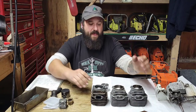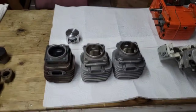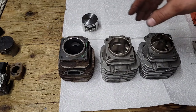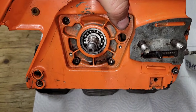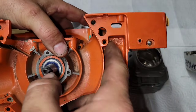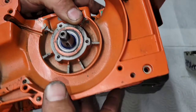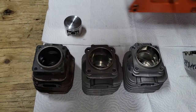Let's talk about the top end we chose — there are a lot of options for these. I smashed my phone last weekend, so I've got a new camera. I want to show you this chassis: the 162, 61, 266, 268, and 272 all share the same crankcase. There are some variances — the older ones have a trigger crank trigger and a coil, so you'll have a two-piece ignition. The flywheel is different on some models, and this is a fine-thread clutch though you can also get a coarse-thread clutch.